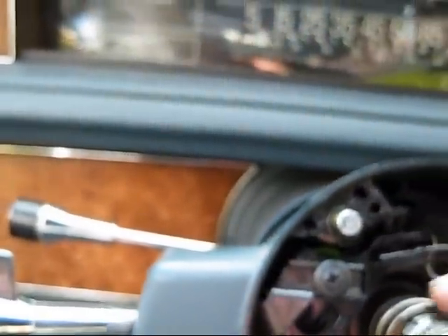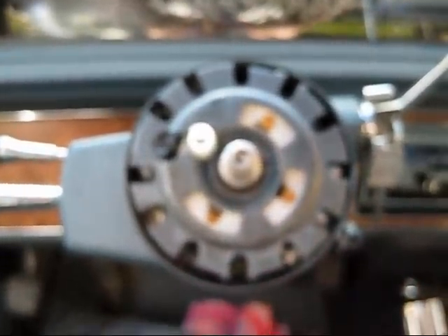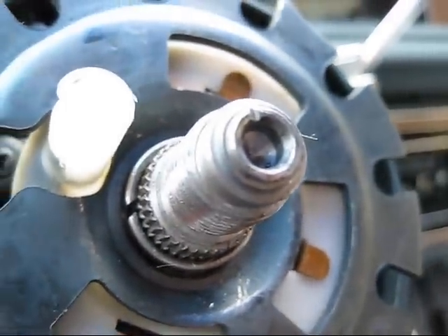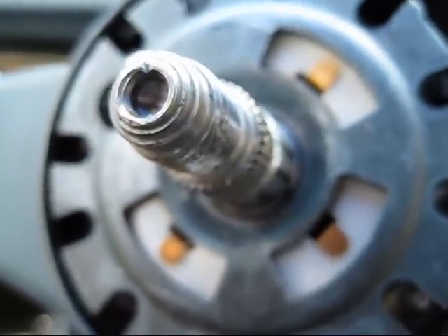Hazard switch in. So now we put the spring back in. Put the cam back in. And the lock plate. Lock plate can only go down on it in a certain way. Now we've got to compress the lock plate again. Make sure you put the snap ring back on before you start putting the tool on. Once you get your snap ring in place, remove the lock plate compressor, and now we can put the wheel back on.